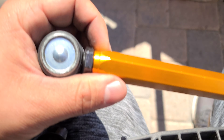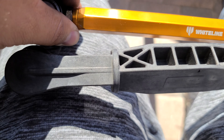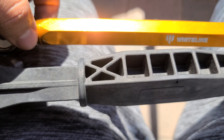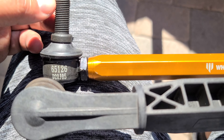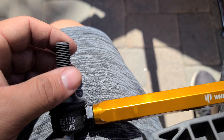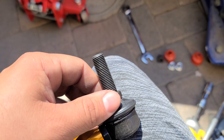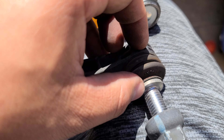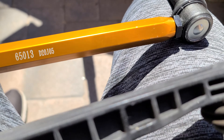These adjust here so you can twist to extend them and do all that. What I'll do is leave the nuts loose for now, and then once I put it in and tighten everything, I'll tighten these up. I'm going to put some thread locker on here to make sure there are no issues. Whiteline did include new nuts that go on here. I think they're supposed to come with washers, but when I took the old one off there were no washers, so I think it'll be okay.